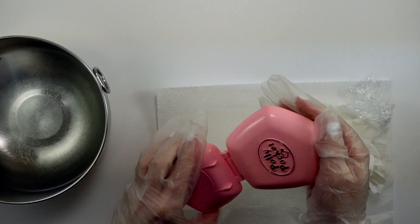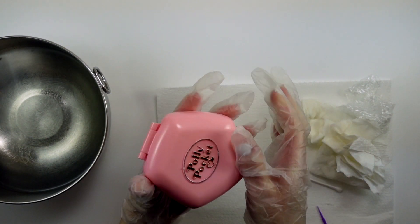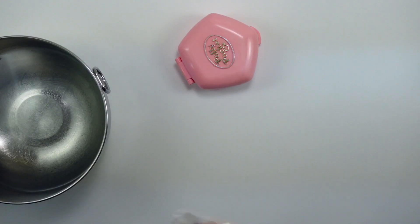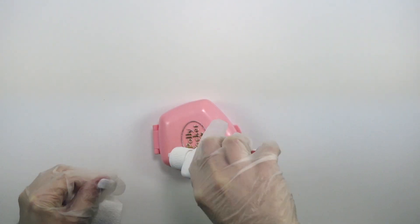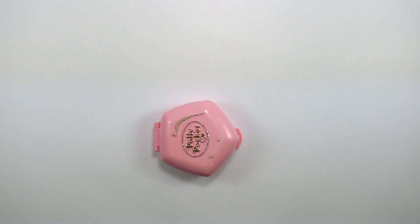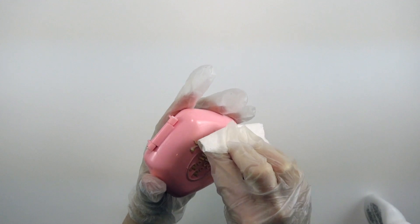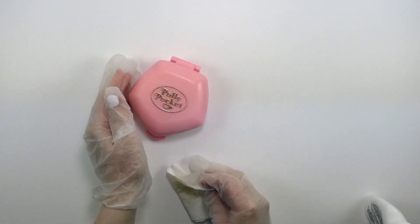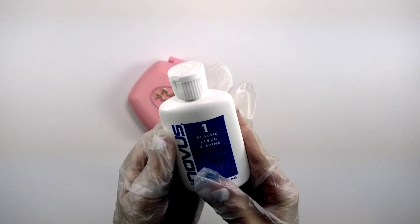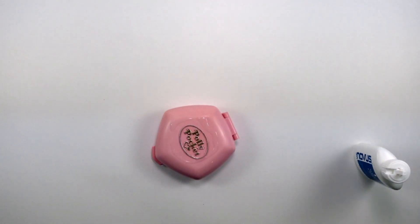It's starting to look really good, but I can see there are still a few surface scratches and I want to get it looking as good as I can. So I'm going in with my Novus Fine Scratch Remover — you've probably seen me use this in other videos — and buffing it out with a little piece of paper towel. Then in step two I'm going in with the Novus Plastic Clean and Shine to clear off any excess residue and get it looking good as new.